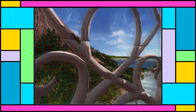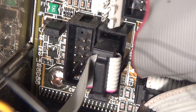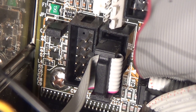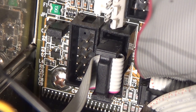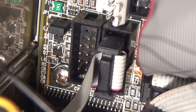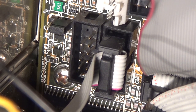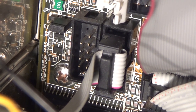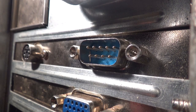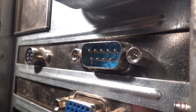There is actually a difference on this one, but it's small, and it's not visual, you wouldn't be able to see it. In days gone by, these serial port headers had two different pinouts, Intel and Everex, I think they were known as. Intel used their own pinout, go figure, whereas almost everyone else used the Everex one. Well, this board also uses the more common Everex pinout, but my original one of this same model used the Intel pinout.